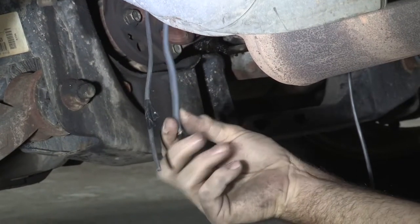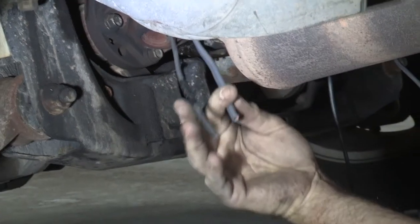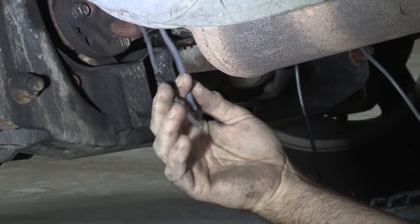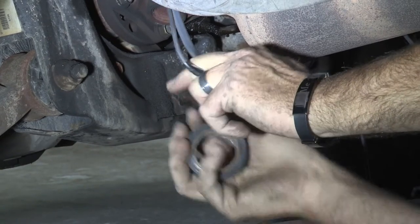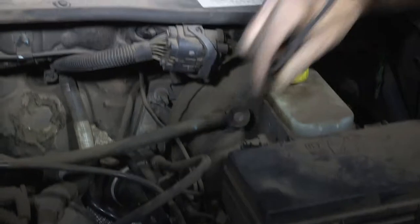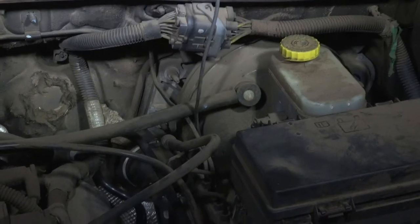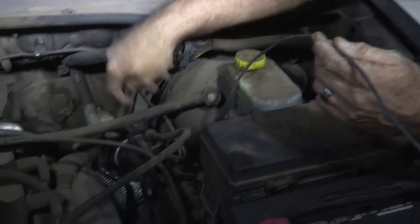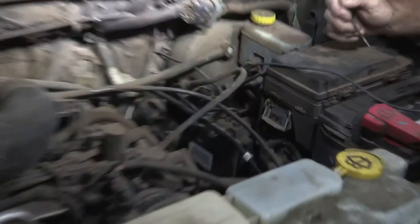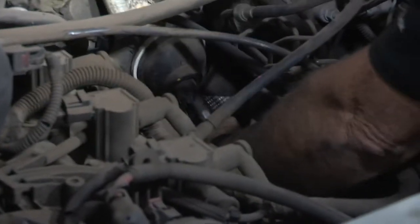Our pull wire came down right next to our battery wire. We'll tape the two ends together, go back up front, and pull straight up. We're back at the engine compartment — wire is connected, now we're just pulling up. We'll continue pulling until all the slack is out, leaving a little bit of slack to maneuver around the steering arm. Now I'm going to take some zip ties and zip tie them to the brake lines to keep everything secure and not loose or dangling where it can get burned or caught on any moving parts.